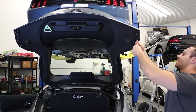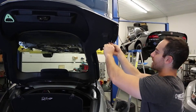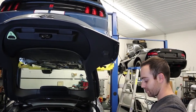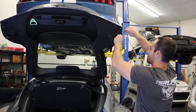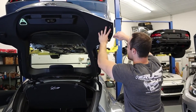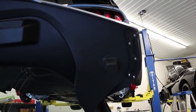I'm using a 3 millimeter allen wrench to install these. If it starts to feel like it's cross-threading, don't go harder — stop and fix it. It's going into aluminum, so once it bottoms out it gets tight; you don't need to go crazy with it. All the studs are installed — I'll give them a quick quarter turn, just making sure they're all fairly bottomed out and even. Then we'll grab the M6 washers and nylocks to finish up the install of the trunk mounts.